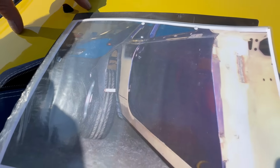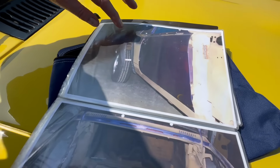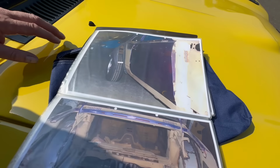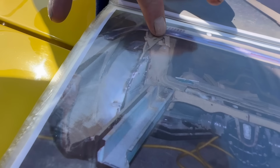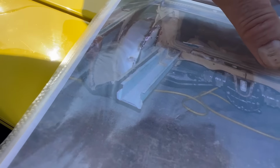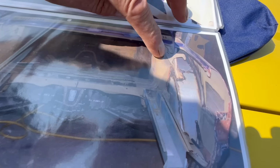See, that's how much wider the wheel arch is for a Ford arch. And it's steel, not fibreglass? No, it's steel. Hard steel. So just make up brackets to make it legal, to cover the wheels, and then fill it in with metal. See, if you look at the Mark 1, this is what we call a cantrail. The Mark 1 cantrail fits on top of the Sierra. This is Sierra here and here, and then this is Mark 1 here.